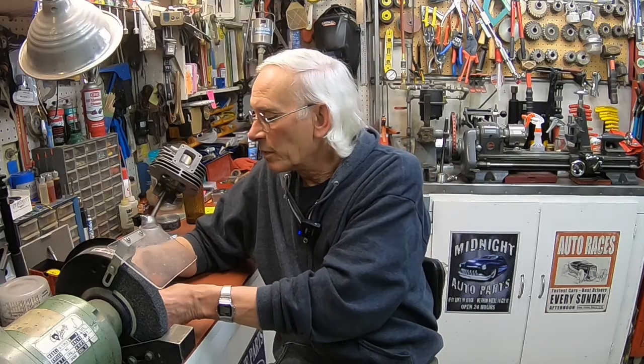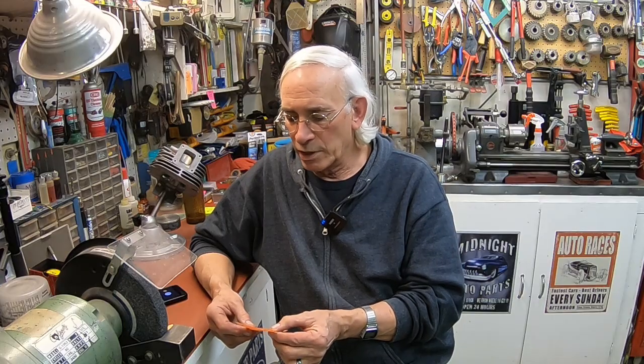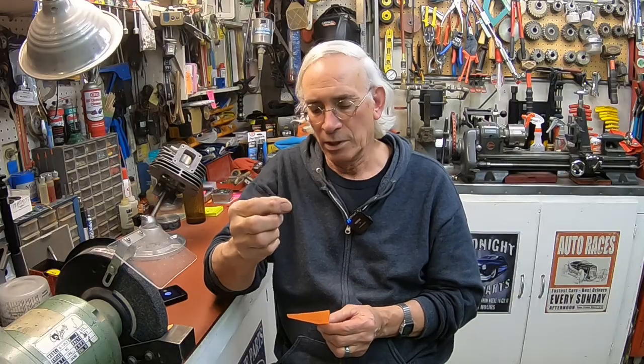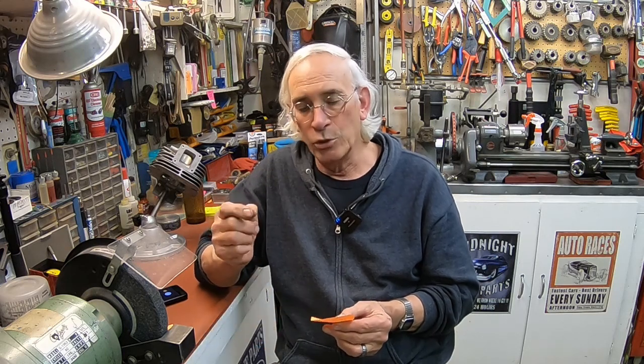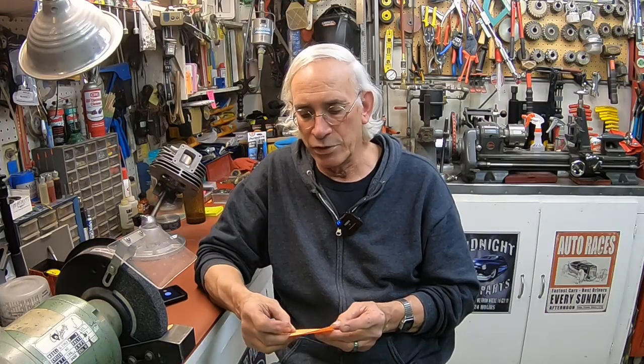So I would ask them first before you buy. At this point, this may have been the only bad set. There may be more. I don't know. But I'll tell you what my dimensions were, and these are just close. With the original ones, I had 17.12 millimeters between the top of the tube and the beginning of the threads. And on the Dachi, it was 13.22 millimeters from the top of the tube to the beginning of the threads.